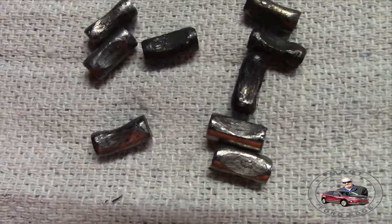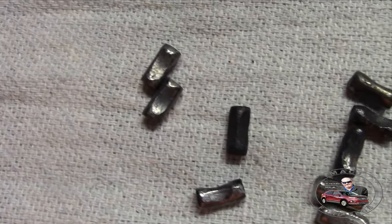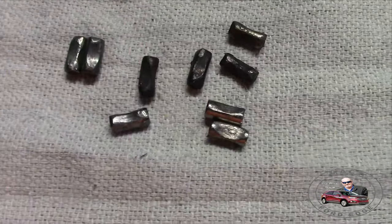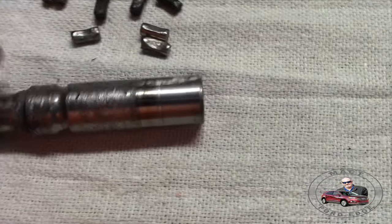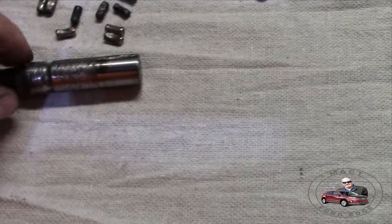Check that out, folks. These things are supposed to be round oblong needle bearings, essentially. And if you look at them, they are not round anymore. They are eaten up. That means they spun around, turned sideways in the shaft, and this is where you're getting more of your metal also. These were worn out and worn on that hardened shaft they were spinning on. They got worn out, and they got deformed. I mean, you can tell how deformed these things are. More steel, more iron in the oil.